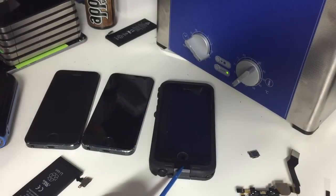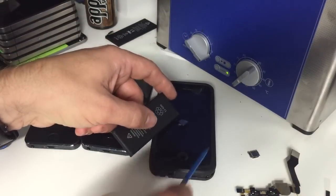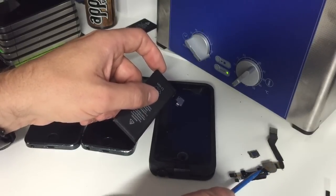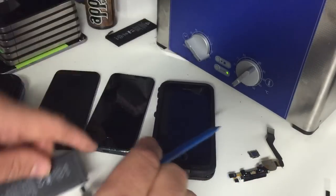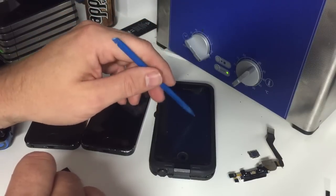You can't do that on a Galaxy - this is a solder repair on this particular Galaxy. There are some that have a flex cable where you can change it that way, but on this one it's solder only. So: if you've checked the cord in both directions with a known good cord and it doesn't work, check the battery with a known good battery and plug that cord back in. If it still doesn't work, then check the port, and if it still doesn't work after that, you can assume there is something damaged on the charging circuit.